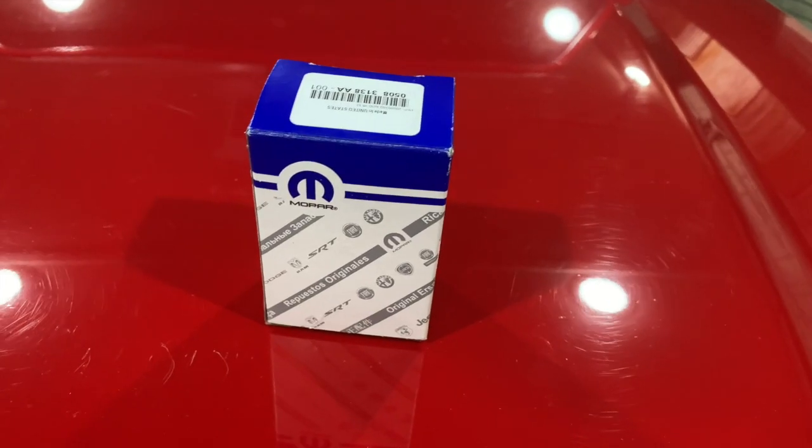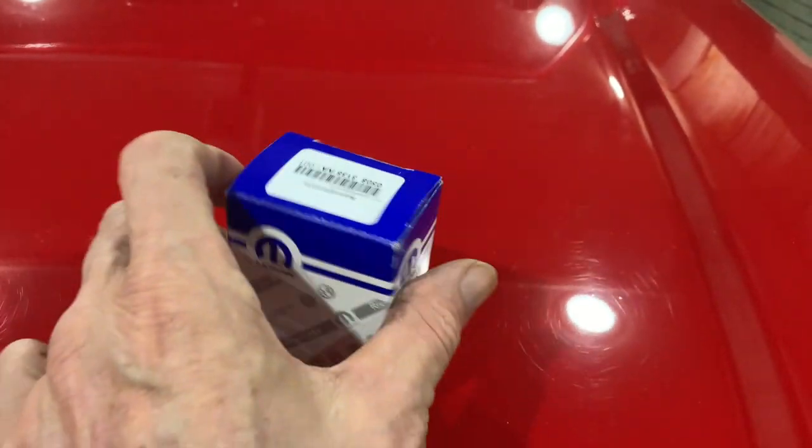It didn't make any sense to me at all, but they talk about how the resistance in the Rubicon switch needs to be different than for a standard transmission. Well, I thought when I bought the switch from AutoZone that I was getting one specific for the Rubicon. Evidently, there's still something else beyond all that. So I ordered a switch from an online store. This is our lovely switch. Here is the part number.